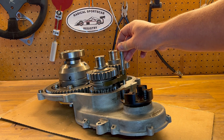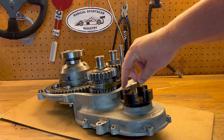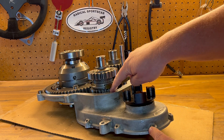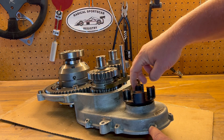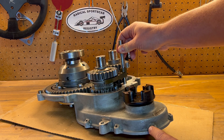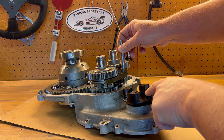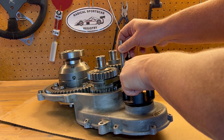This is the reversing lever for the reversing fork. In the down position, that's forward. With engine power, it goes through the input shaft, through the ratio gears to the main shaft, and then turns the idler shaft forward, which drives the differential forward. If you pull the reverse handle inside the car, that'll pull that fork up, and the power still goes in the same path but it's going through the reverse gear over to the idler gear to the differential, driving the differential in reverse.